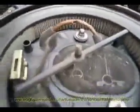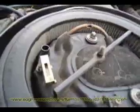We'll start with the hyzor. What it does is simply make brown's gas. I can fill it very easily with a syringe through this vacuum cap. When the water splits, the gas comes out this hose, goes over and up around, and into the air filter housing outside the air filter, so all the gas has to come through the air filter to get into the engine. That keeps any residual lye contained, and it also keeps any engine backfires from backfiring into the hyzor. The gases then go into the engine and help increase combustion.